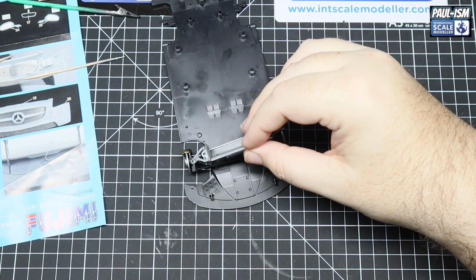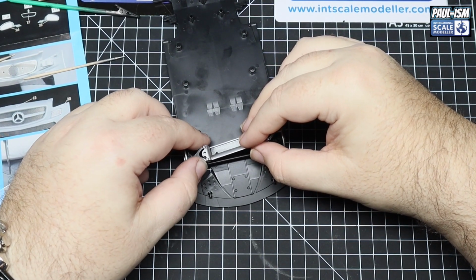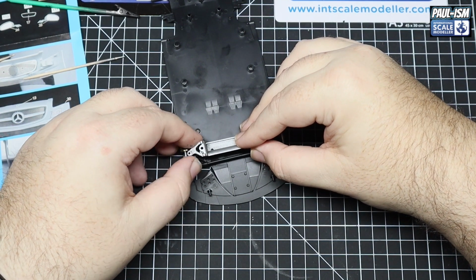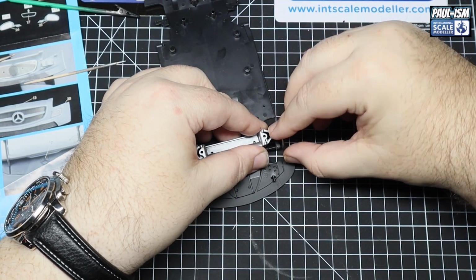And this is what I mean about the simplicity. So you've got the chassis floor pan. We've got suspension struts, our hubs with our brake calipers on, the steering rack, if you want to call it, and this subframe that goes on top. And that is it. There's nothing else. None of this can be seen anywhere. All we're going to see is the brake disc through the wheels.